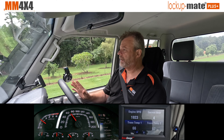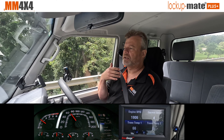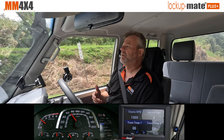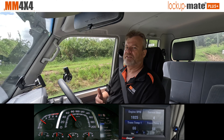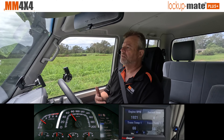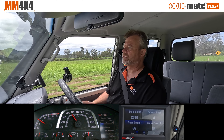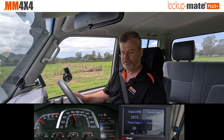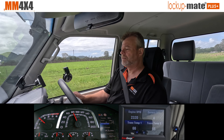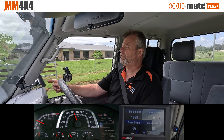The kit is fully automatic in operation. It has lots of protections built in, so you can't be locked up at, say, 1,200 rpm and things like that. It's essentially set and forget — there's nothing you can do to damage the car using the kit. The way you control it is through the shift lever. So in fourth gear, if I get the car up to 80k and go into fifth, you see it's in fifth gear and it's remained locked.